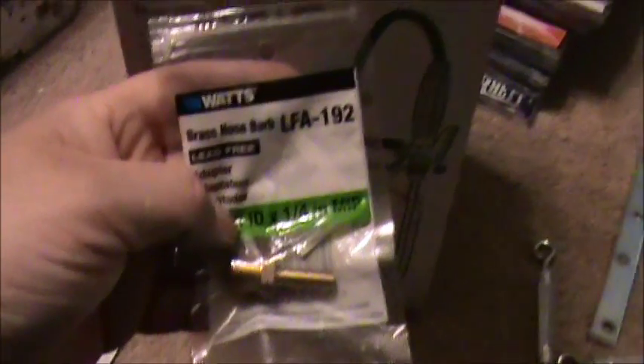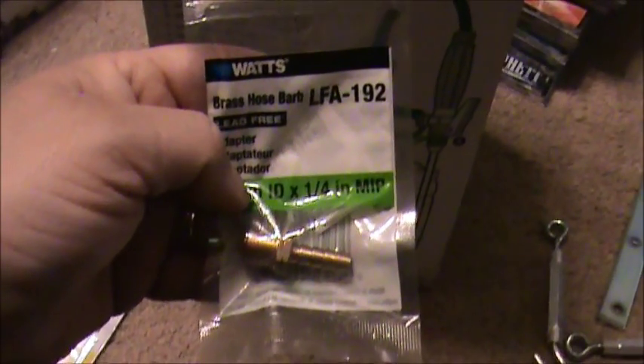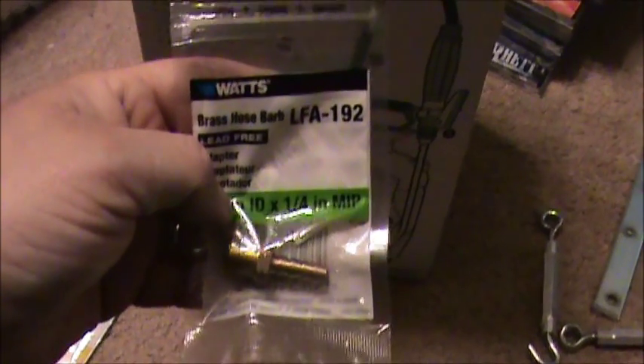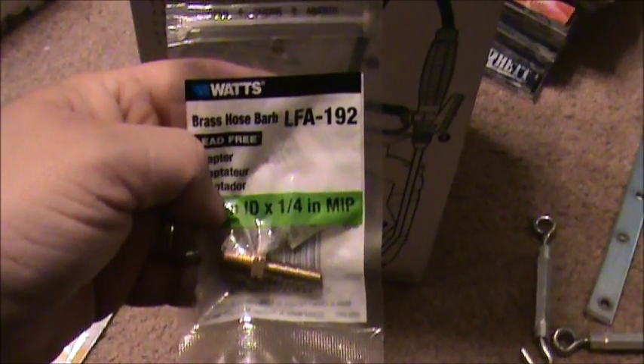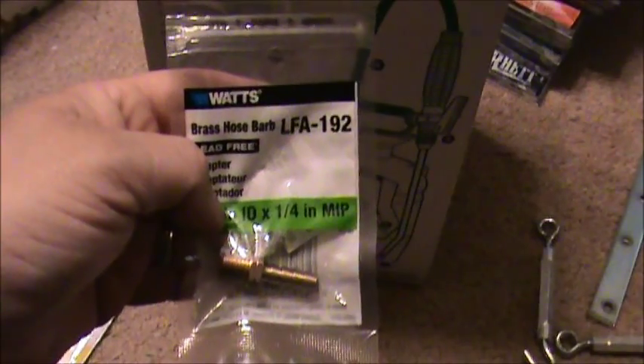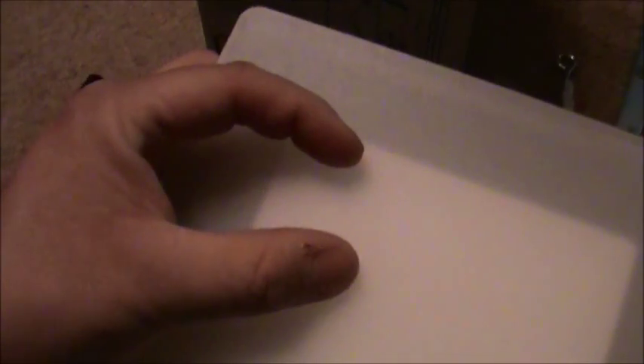You've got two reservoirs — why not use a T? Well, you can only do the front or the back at one given point in time, unless you want to be lazy and do both at the same time, which then you could use a T, but we're not going to. To switch between front and back, we simply turn this board around. That'll also allow us to handle cars that have a single round reservoir top — your board may be square but you can still put it over top with a piece of inner tube for a seal.